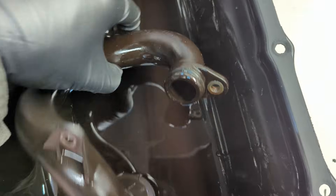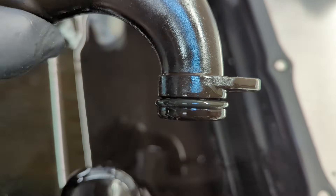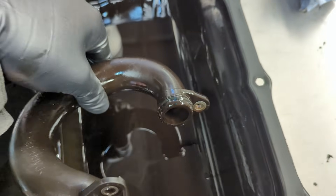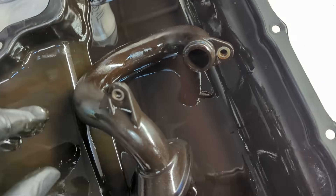Here's the new O-ring installed on the pickup tube. It's sitting proud of the rest of the tube — that's how it should be. Hopefully that seals up and we get oil pressure at idle to stop the ridiculous knocking sound.